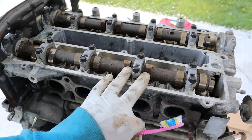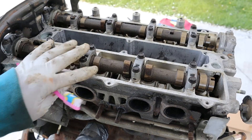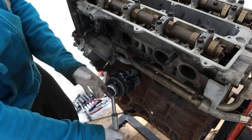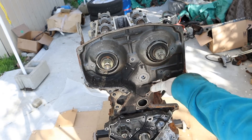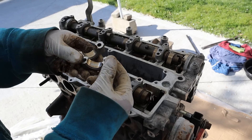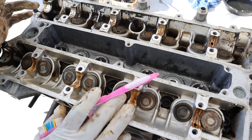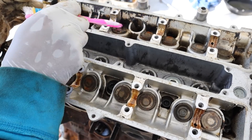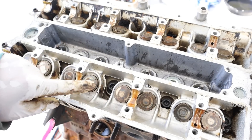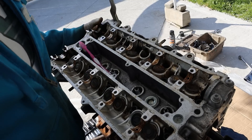This is the exhaust side with two exhaust valves per cylinder, and this is the intake side with again two valves per cylinder. It wasn't until the late 90s when this engine got variable valve timing, but there was no variable valve lift system. Looking at the exhaust camshaft, you can see some slight scoring on these cam bearings with some rust build-up. The intake doesn't look nearly as scored, but unfortunately on the intake side we do have quite the sludge build-up. This uses a direct-acting cam-on-bucket design rather than a rocker arm style. The head bolts are actually an 8mm hex and these are pretty loose — I'll zip these off.